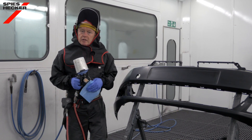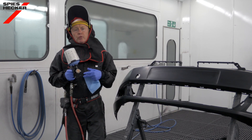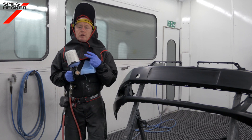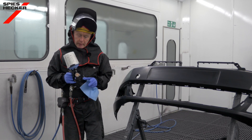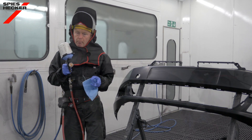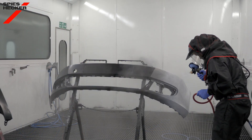Take a gun with a top coat set up of around 1.3 or 1.4, which will give us the best lay down with the primer surfacer so that we can apply the base coat directly to it. For the gun itself, set the inlet pressure to 1.5 to 1.8 bar, which is around 22 to 26 psi.